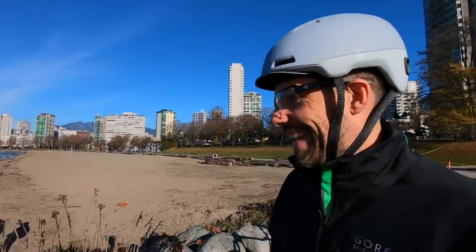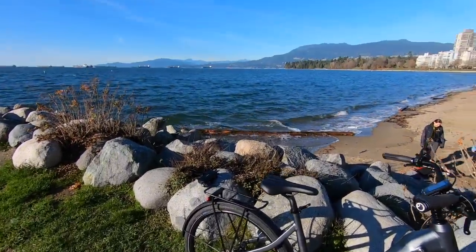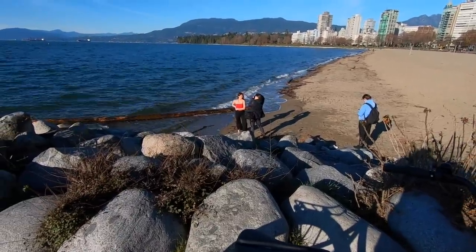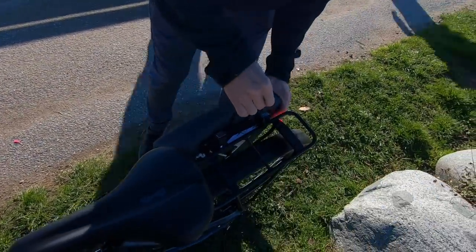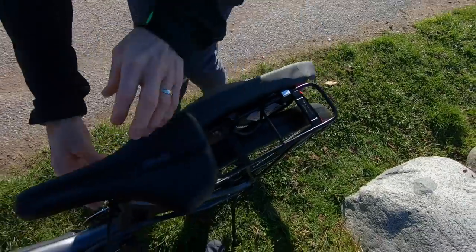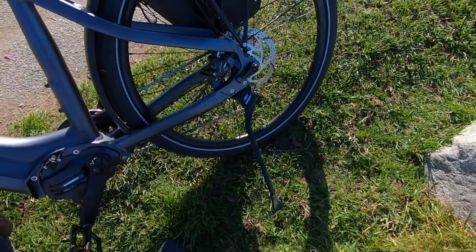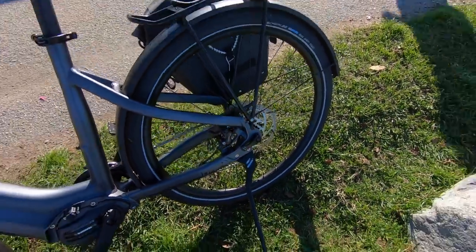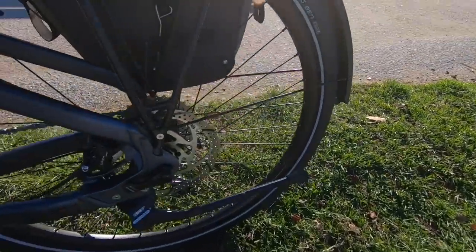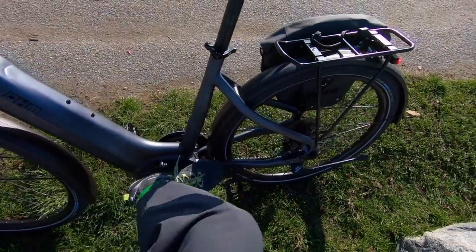Is there anything we missed? You covered it all — let's hop on these things and take a ride. This is a Pletscher kickstand, not adjustable length, which might keep it a little bit lighter and more durable, with excellent positioning. The wider-style kickstand isn't hitting that disc brake rotor. It's also far enough back that you're not going to get heel strike while pedaling. Let's take it up to the highest level of assist.